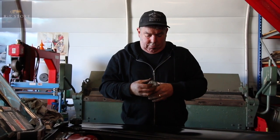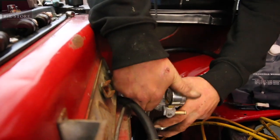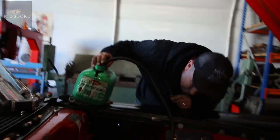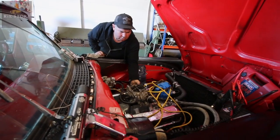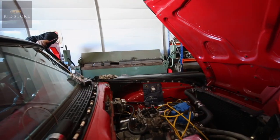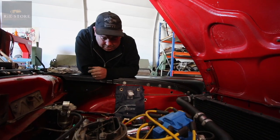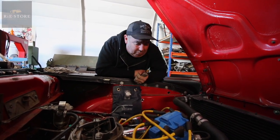It's loading up. It should be clear enough. Looks a bit healthier, doesn't it? I can't see it being the carburetor - there's not enough in there to warrant it going wrong. Unless it's just jetted completely wrong. All I can do now is go back to basics, check the compression. If it's got good compression all around, then it's not valves, it's not rings.